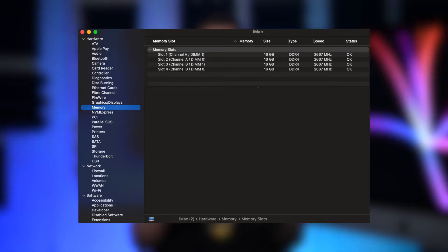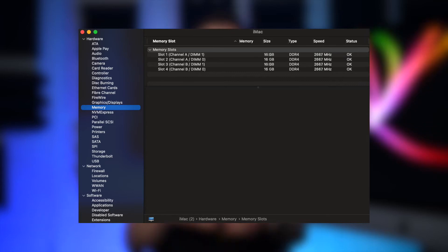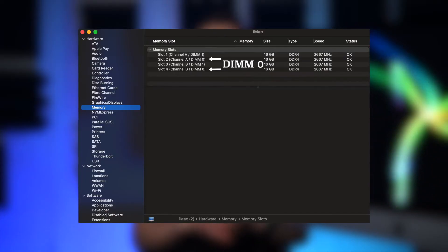Option 2 is to take two fresh sticks and put them in the RAM slots that are not occupied — slots 1 and 3. If you purchase anything besides 4GB RAM sticks, you're going to be mixing your RAM capacities. This will work, but your RAM speeds drop from 2667MHz to 2133MHz. I've seen online that if you reconfigure the base sticks into slots 1 and 2, and put your purchased ones in slots 3 and 4, you can get RAM speed back to 2667MHz — do not do this. Even though system information states you're back to full speed, Geekbench tests show you get about half the performance. To summarize, you get the best performance using two or four RAM sticks of the exact same capacity. If you need to mix and match, make sure you slot the RAM in DIMM pairs, though this will result in a speed reduction.